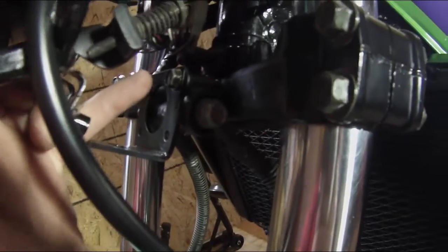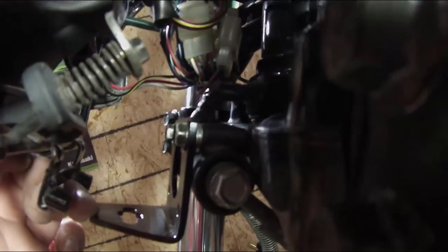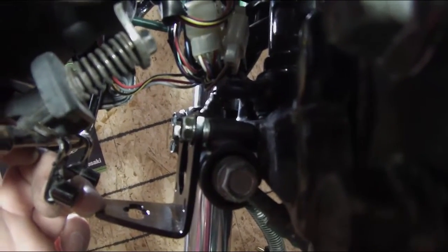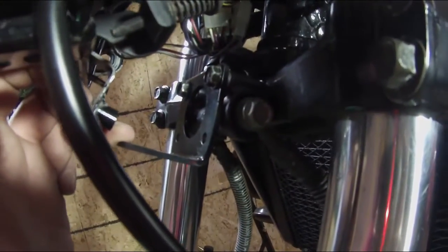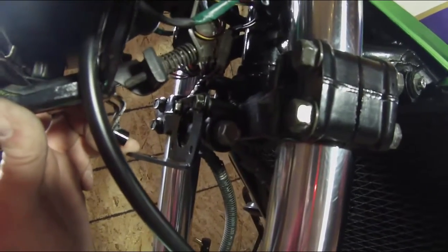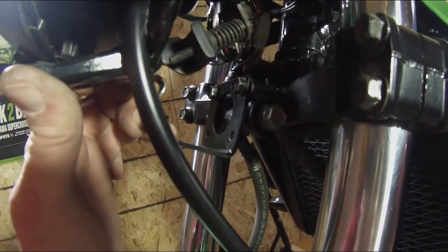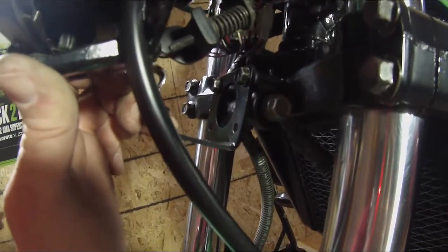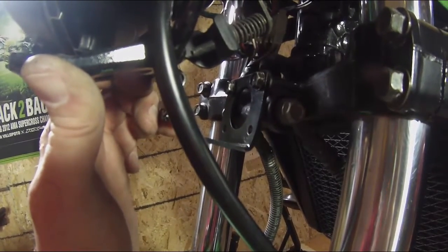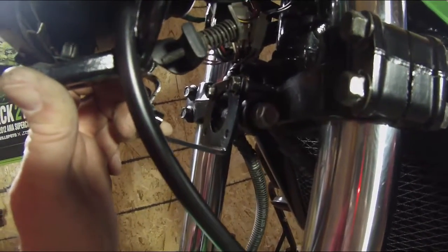I used the OEM bolts that hold the cowl frame on to attach the bracket. Because it's not flush with the mounts on the brake line splitter, I used two washers in behind. That was just to make it a little more level and not squat as I tightened it in, making it dip down on the bottom end and move in towards the bike. It seems to be a flusher mount this way. The instructions do say you might have to vary the installation slightly. So this is my slight varying. Maybe it's just being a little bit picky, but it seems okay.